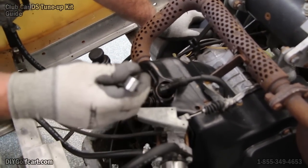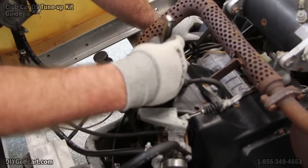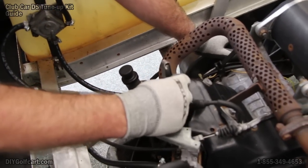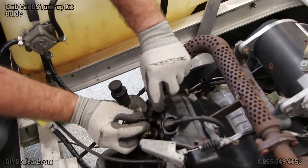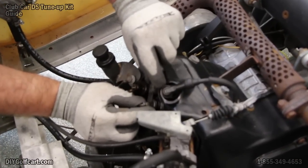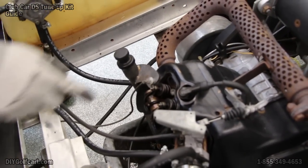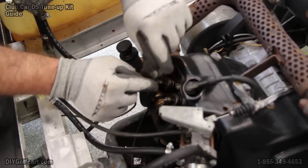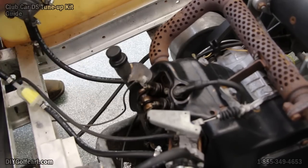What we want to do is get our valve gauge here. Let's get it at 4/1000ths. Turn your engine till it gets to top dead center. Both valves are up. And check, make sure your clearance is good and smooth. What you're wanting to do is make sure you can get it in there and it moves back and forth, but you feel it pull just a little snug. These are perfect. If I had wanted to adjust them, I just loosen the nut, tighten down on the center portion, hold it, tighten the nut up, then check it again with my gauge till the 4/1000ths fit perfect.